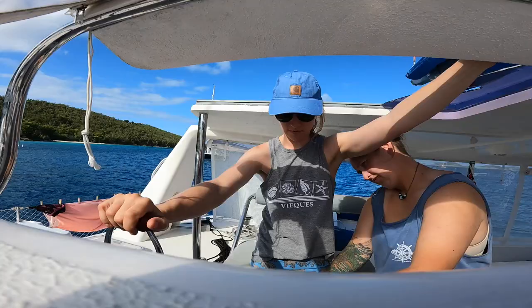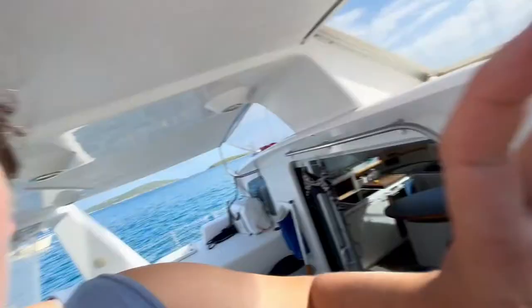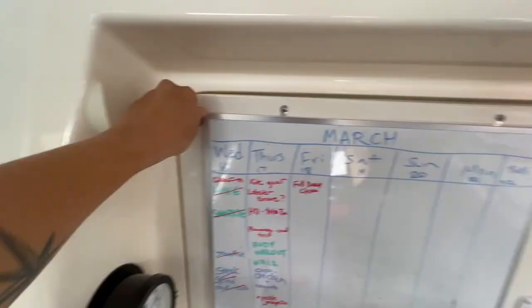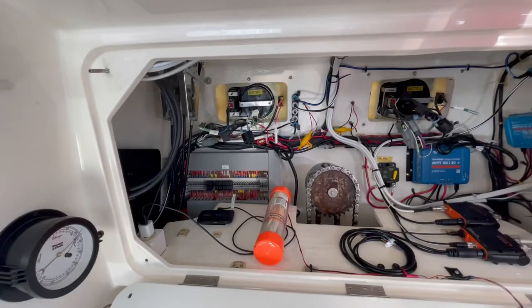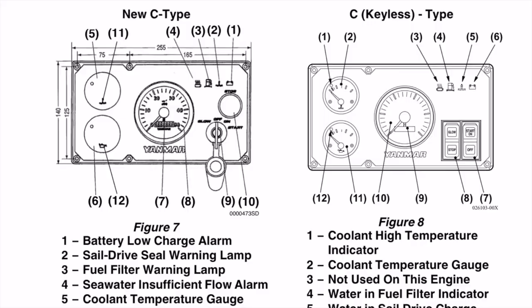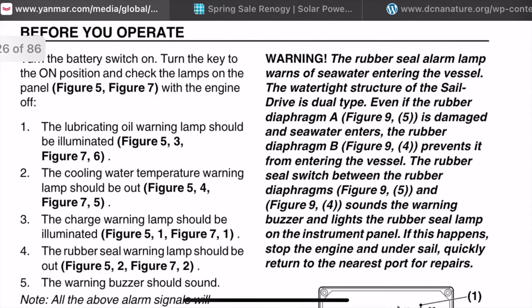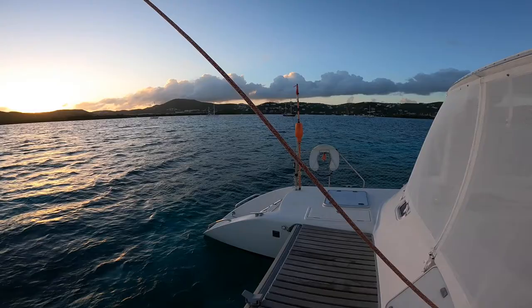What's that symbol? There it is — it means there's water in the sail drive, which isn't good. We're going to disable that alarm for now. This is the alarm, so just unplug that — super noisy. So what we're seeing is the sail drive seal warning lamp. When you first read about it, there may be sea water entering the vessel. Yanmar suggests if this happens, stop the engine and under sail quickly return to the nearest port for repairs.